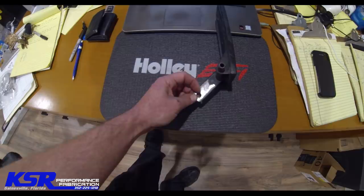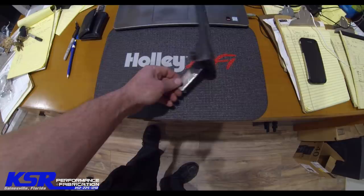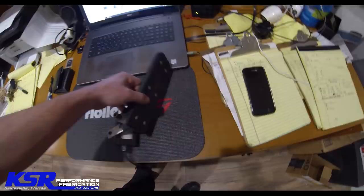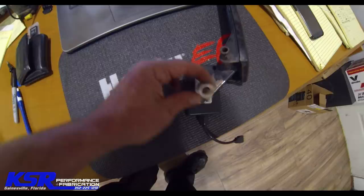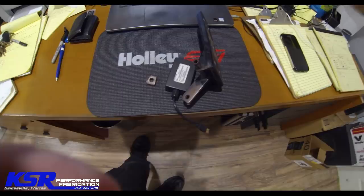So actually the way it fulcrums is it pushes on this throttle cable adapter, and then there's another piece under the golf cart that flips it around and turns it into a pull mechanism. So what we're gonna do is make it to where we can, I wish it would stay up. That would be very helpful if it would stay up. We're gonna make it to where this piece, I think I want to attach it somewhere in here, so I'm going to cut this off and space that up there so that we don't lose any distance that it can travel, and it won't put the piece that's in there under a bind. So we'll get it made, and then we'll give you some details, show you how it actually operates inside of the golf cart.